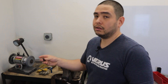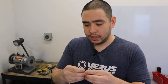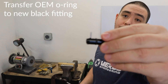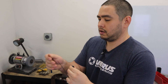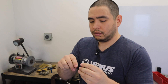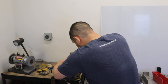That will form kind of like a little bit of a taper. That taper will let you start the pin a lot easier by hand or by just gently tapping it with a hammer. Just be careful you don't scratch your nice anodized piece. So we have our adapter started. We've got the pin started and we have the set screws started. Now, the hole in the dipstick is for the pin, not the set screw. Basically push the dipstick all the way in and tap the new pin.